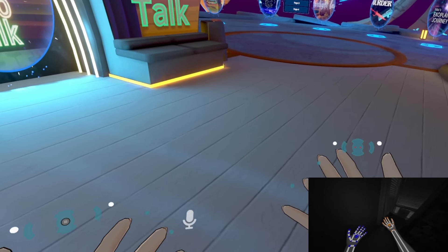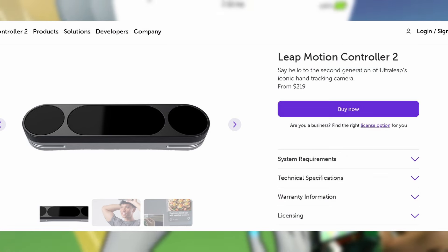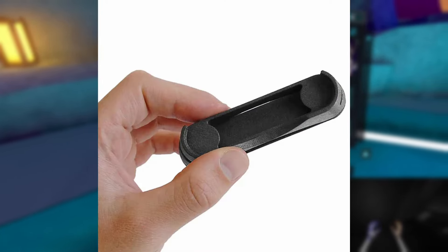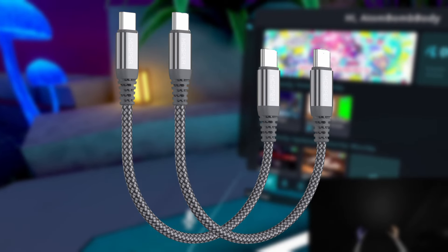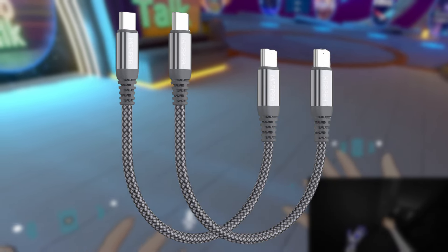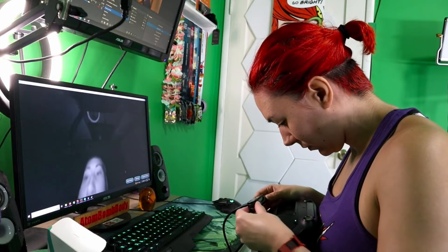For those wanting to try the Leap Motion 2, here's what you'll need. I'm using a Valve Index because it's what I have and it's easier to plug the Leap Motion in thanks to its frunk. First, make sure you have a Leap Motion 2, which you can find from their store or through my affiliate link in the description. You'll also need a mount — it's a 3D printed mount with a sticky back that you can purchase separately. Buy yourself a USB-C female to standard USB male adapter, a really short one. For comfort, you may also want to find as short a USB-C to USB-C cable as you can. With the mount attached to your headset, plug everything in.